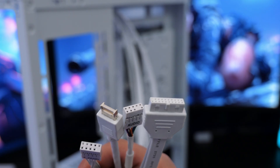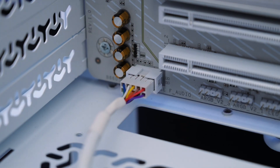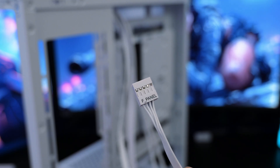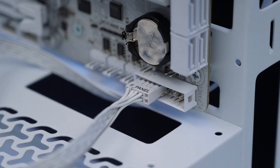Now the board is in place, I will connect all of the front I/O cables. The audio connector goes at the bottom left of the motherboard here. The USB 3.0 connector goes here. The Type-C connector goes here. And lastly, the power and reset switch is conveniently combined on this case and it connects to the header on the bottom right of the motherboard here.